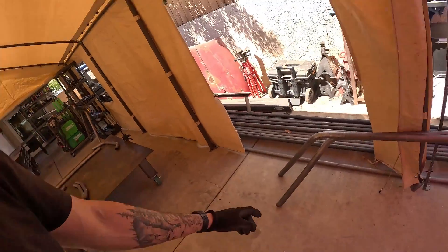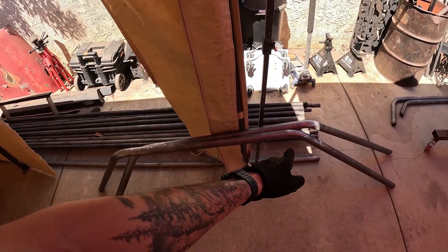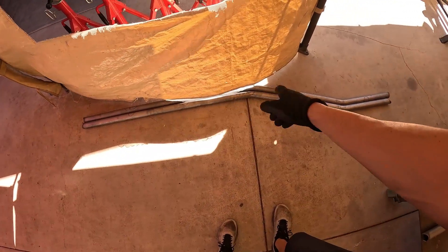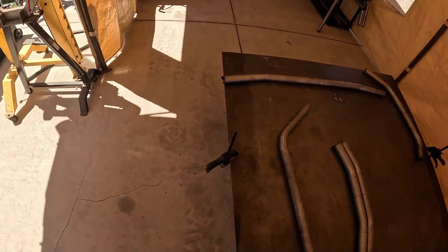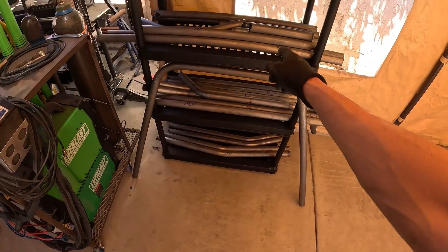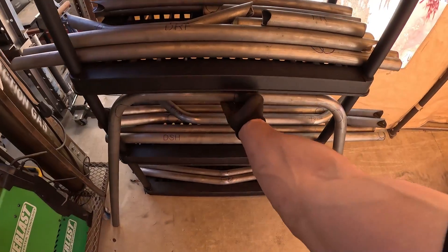A couple differences between the DIY chassis you guys are going to receive and the one I'm doing. The one I'm doing today is a two-seat chassis — if you're doing a three-seat chassis it's the same process. You're just going to have an A-to-C pillar that's sleeved at the B pillar. The main frame rail on mine is solid all the way to the front; yours will be split at the front of the cab going forward. Also the rear main upper tube on the back in the DIY kits is cut and sleeved in the center — really just for packaging on a pallet.